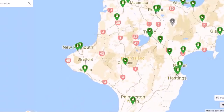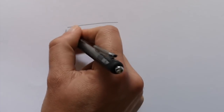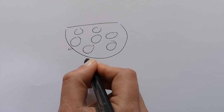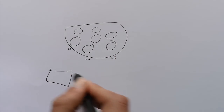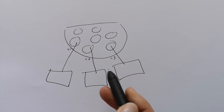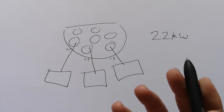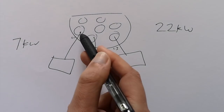The Warehouse is installing a whole bunch of three-phase Type 2 stations at each one of their stores around the country. But the problem is not all these stations are three-phase — this one for example is single-phase. With a Mennekes Type 2 inlet you have your three phases. A popular way to do it on the Zero is to get your three DigiNow superchargers and just wire them up to each phase. So you go to a three-phase station — they're usually 22 kilowatts — it's insane. You just pull all three phases across all three chargers and you're good to go.